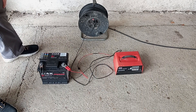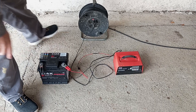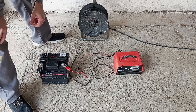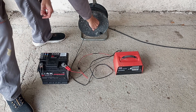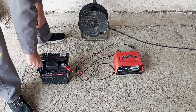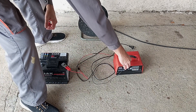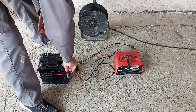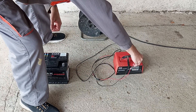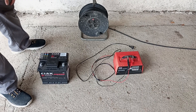Let's say the battery has been charged for six, seven, or eight hours and you want to turn the charger off. The first thing you should do is disconnect the charger from the power outlet. After that, remove the minus clamp and then remove the plus clamp. And there you have it — the battery is ready for installing onto the car.